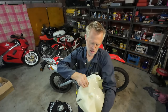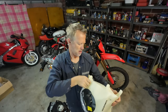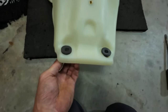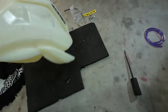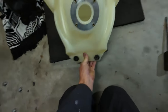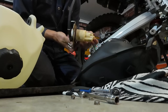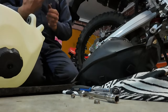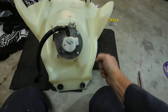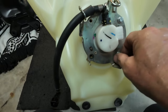Right, fuel tank — off-road use only, yeah right. Just put all these rubber bungs in: two in the front, two in the back. They take a little bit of doing but you can fiddle them in. Undo these four nuts — just need to orientate it differently. If you swing off these with a big long wrench and start tightening, it is going to pull the brass inserts out of the plastic.